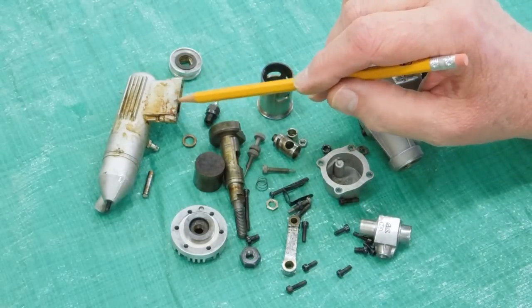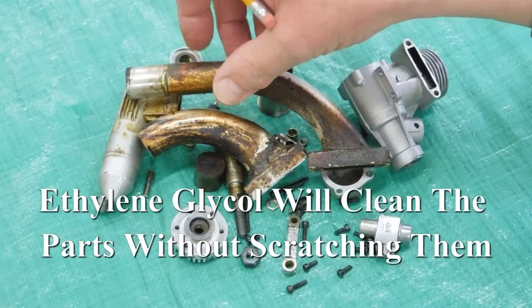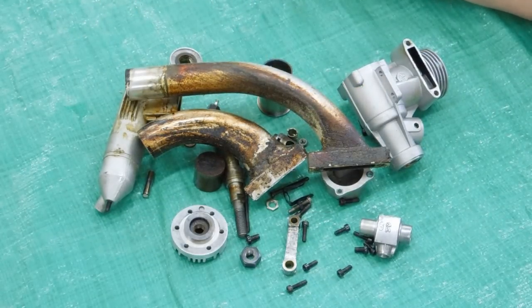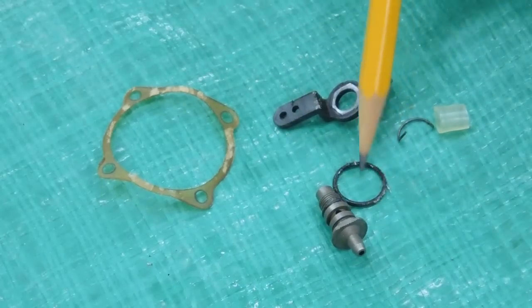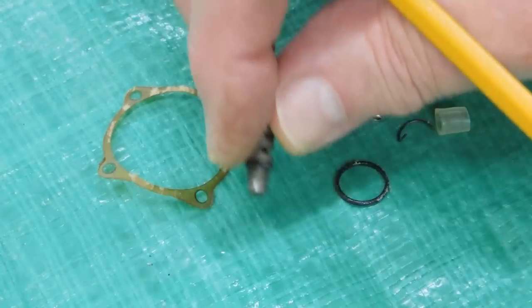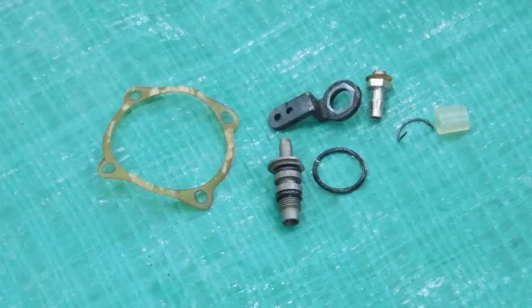The inside of your mufflers and inside of exhaust pipes for tuned headers and other pieces get very nasty. You get a lot of stuff that's burnt on and deposited inside these pieces, and the ethylene glycol will get in there and loosen that stuff up. This is a pressure tap off of the muffler, the control bell crank for the carburetor, a little spring, and an O-ring. I've chosen not to mess with this piece — it's actually quite clean and I don't want to mess up those O-rings. I wouldn't put plastic or rubber into this — the carburetor cleaner will completely dissolve them, and just as a matter of habit I'm not going to put these in the ethylene glycol.